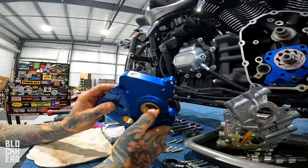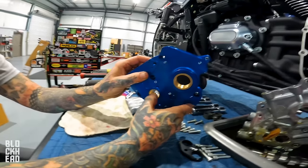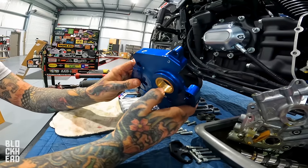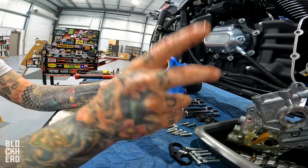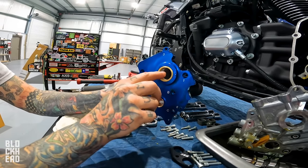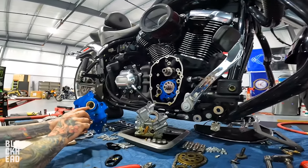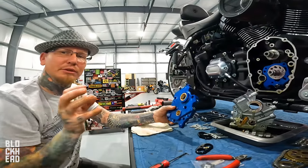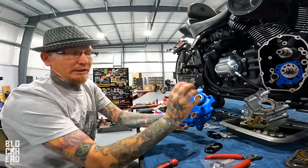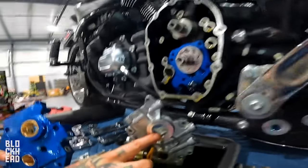This brass bushing, I don't know if you noticed, has a small channel cut all the way around it in both ends here. That is fed by oil pressure. So in essence, we can't see it, but there's a small oil gap between this brass bushing and this surface, and it's being maintained by the oil pressure. It's like the oil is keeping it from actually touching. This does a very similar thing.